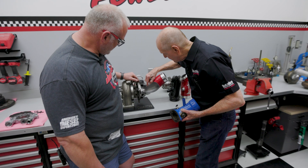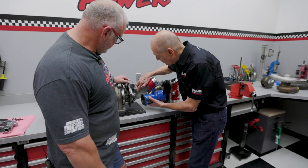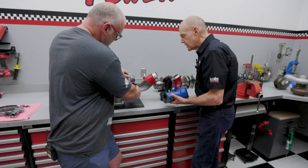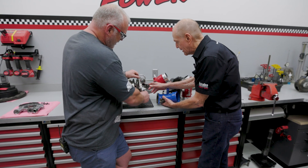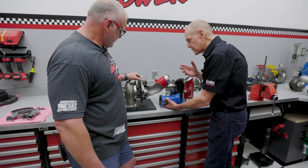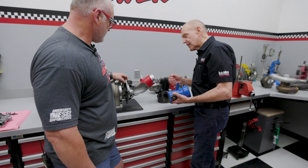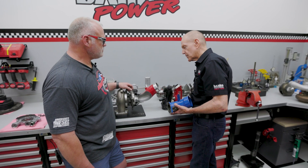This whole section from this surface in — all this part is missing. You go from having maybe 3/16ths or so of a gap to almost a half inch or more of gap. There's no way the surge system can work. And it's not just lugging into it — rolling onto a freeway, that's where this will really manifest itself if it's wrong.